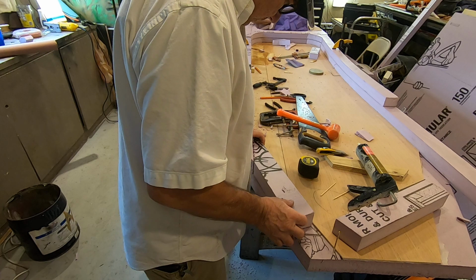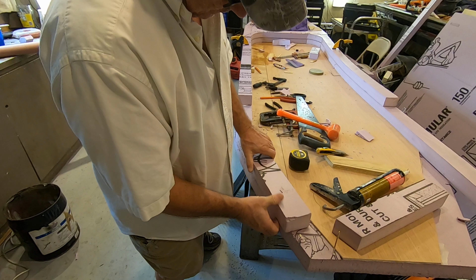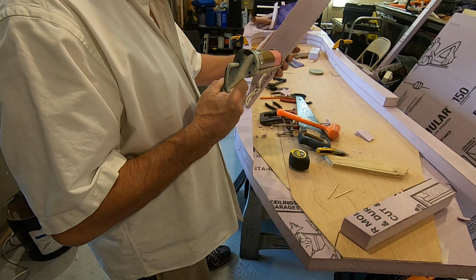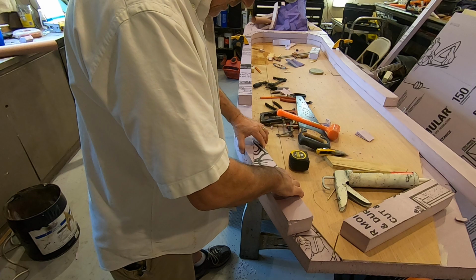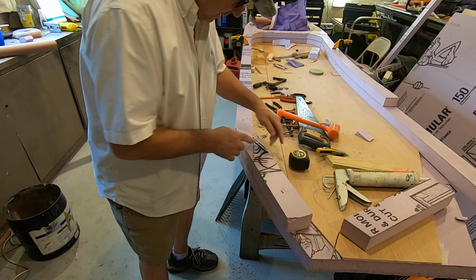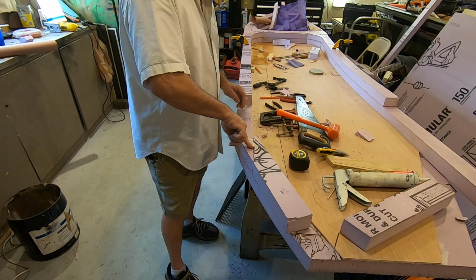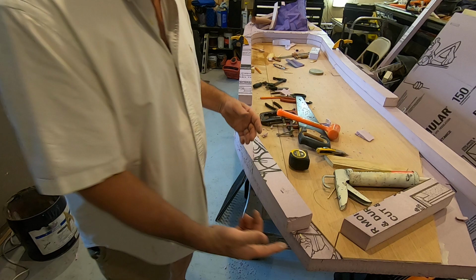Yeah, 'cause I'm just gonna fill that up. Yeah, that'll work just fine. And all this stuff really doesn't matter. If you color outside the lines just a little bit, it's not gonna ruin it. You can still cover so much with sandpaper, sanding it down, and then when you put your final layer on there, if you're doing fiberglass, you can float it out with Bondo and get it up really nice with Bondo.